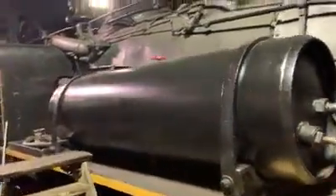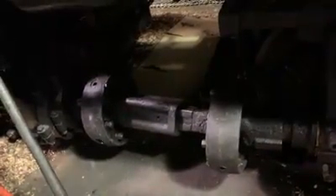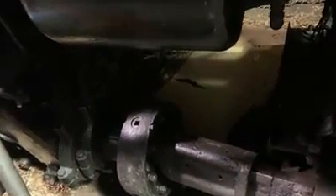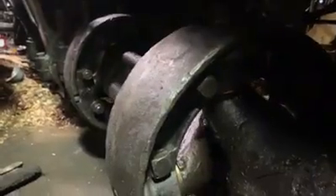We'll do a little walk around here on engine 15. Come down and look at the front truck — you'll see that it's been assembled. Take a look at this point right here. You'll see two coupling links and the universal connection in between. Those holes on the top are where the lubrication happens. The horn is just below that point. You'll see one of the horns on the side — that's the one from the universal. Up here on top, that's the one connected to the line shaft for the front truck. This part of the locomotive is ready to go.